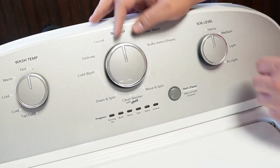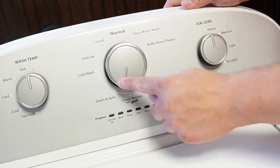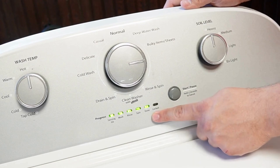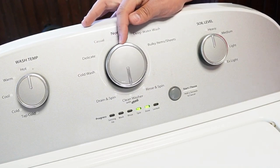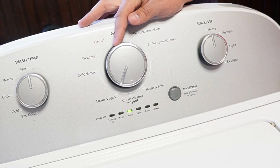It should be pointed at this point at 3 o'clock or all the way to the right position. You need to do all these things within three seconds, and it may take a few attempts. But if you've done this right, all the lights at the bottom of the washing machine control should flash on and off, showing that you've entered into the diagnostic mode. Once you're in this mode, turn the knob clockwise four times. The rinse light should be the only one illuminated solidly by itself. This is the recalibration mode.